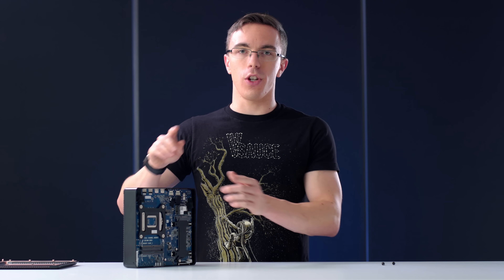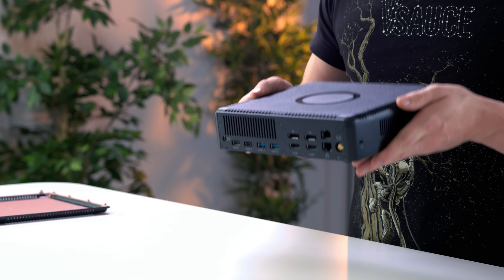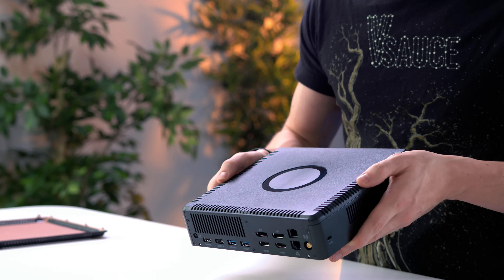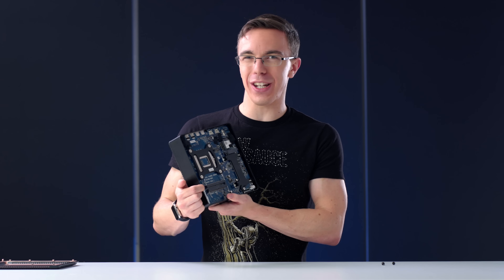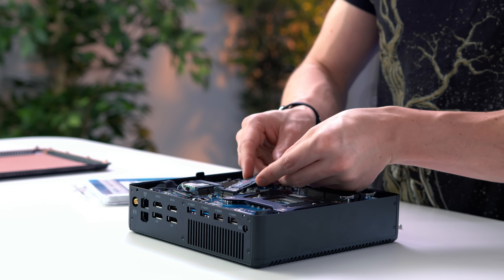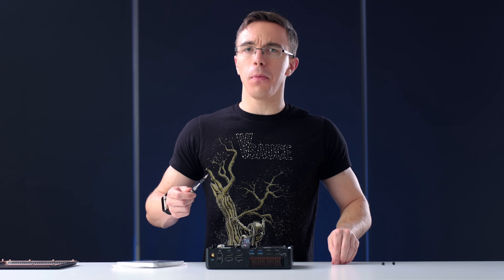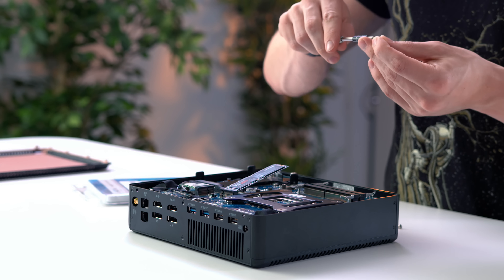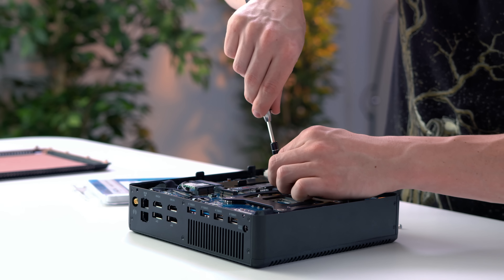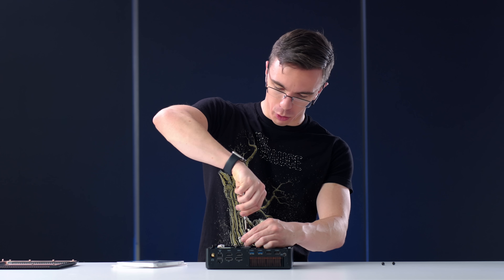Now what you can't as easily upgrade are any of the core internals, such as the CPU or GPU. As you can imagine, with something like this, they didn't exactly just cram a normal GTX 1070 inside. However, there's a big warranty void sticker right here, so I might want to think twice about that. So for this system, I'm installing a Samsung 950 Pro. If this was going to be my main system, I would probably also take advantage of the two-and-a-half-inch drive, so something like a really fast NVMe SSD paired with maybe a two terabyte hard drive would really be the best of both worlds.